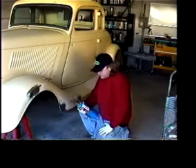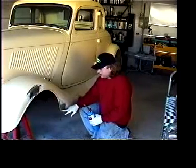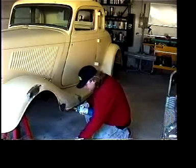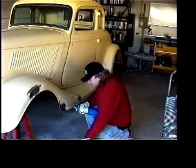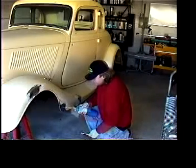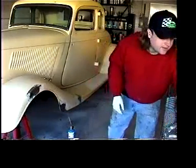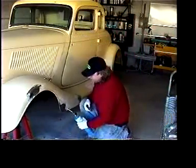Okay, my torches are out of gas, but this simple propane torch will work just fine. I just got to heat. I've removed any paint or anything from the surface. It's completely wiped down and prepped. And I'll just begin by heating up the panel until it's hot enough to accept the solder. And I will solder past the point that I want my lead filler to fit. Then I'll take my bronze wool and I'll smooth the tin out the way I like it.